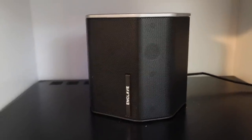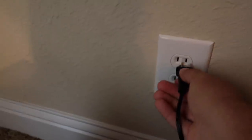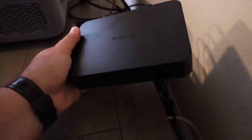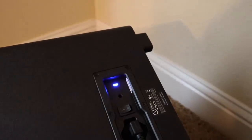All you have to do is take the speakers and all the power cords out of the box, place the speakers where they need to be, plug them in, and then connect the Cinehub to your television or projector with HDMI. There is a setting you have to enable on your TV — specifically HDMI CEC. Make sure that is turned on, then power up your Cinehub and within about 10 seconds all your speakers will be connected wirelessly.